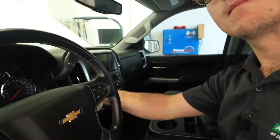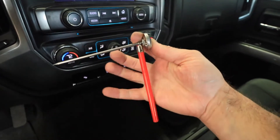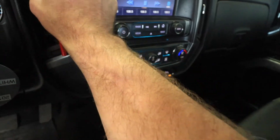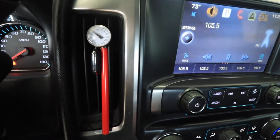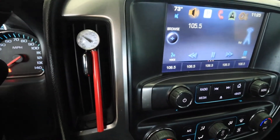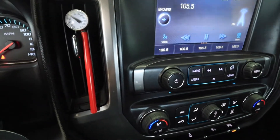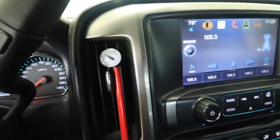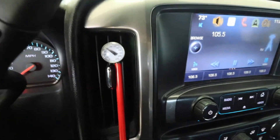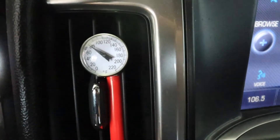We're going to take a look on our Silverado here and just do a basic check. I can put my temperature probe together like this — that provides a little bit of a ballast or counterweight that in some cases will help it stay in the vent a little bit nicer. When I go to pick a vent I want to make sure that I'm using something in the center, which generally has the best flow from the evaporator box and gives me the most accurate reading. Sometimes the vents on the outsides will read a little bit differently.